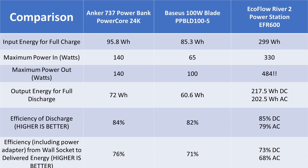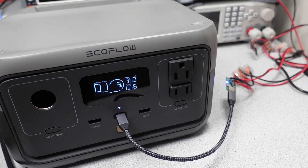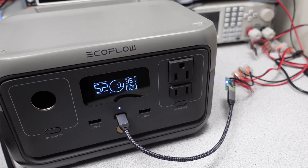I don't really have any direct comparisons for this yet, but we can look at the data compared with power banks I have looked at, which were of reasonable efficiency. This isn't the best for efficiency, but it is far from the worst. You will have to spend some extra energy to use the energy from this battery, as with all battery packs. To use the DC output power of this device, you end up having to spend about 73% of the system efficiency. This device does plug into the wall and use AC power, so as an AC power consumer it can get a power quality score and end up on the database, but it isn't yet. Power station is kind of its own thing, but we'll have to make it in the power bank category for now.